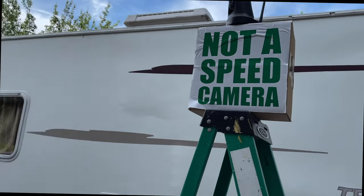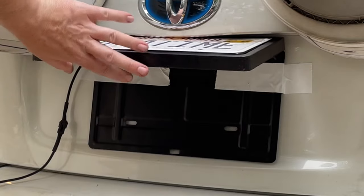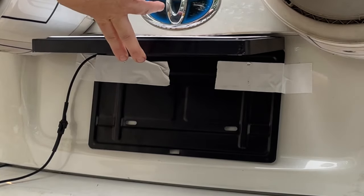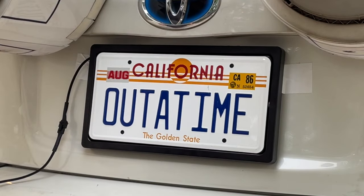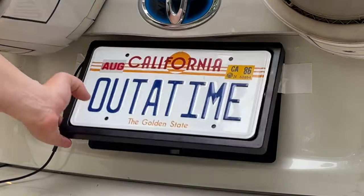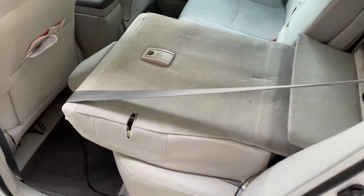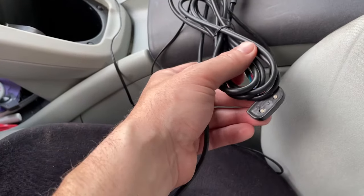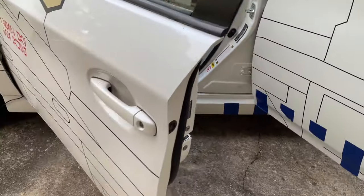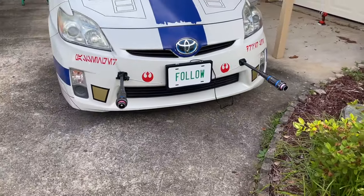So now we've set up our — not a speed camera. Even if I did have flat-headed bolts, I would not have been able to mount them on my rear plate. The mounting holes on my car did not line up well with the mounting holes on the flipper — I would need a couple extra inches of clearance above to match up the holes. So beware of this if you're planning on buying a flipper. I'm just demonstrating it, so I used mounting tape and duct tape to temporarily attach the rear flipper. Starting at the rear of my car, I have the rear flipper plugged into the rear extension cable. That cable runs into my trunk, through my back seat, across the floor, and up to the control box. The control box has the indicator lights, which you could run up to your dashboard, and the control module is plugged into the 12-volt car power supply. The front extension cable is running out my front door and up to the front flipper. My setup is a temporary demonstration — proper cable routing and mounting would be needed for a permanent solution.